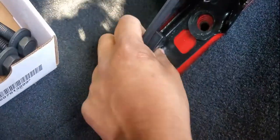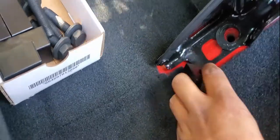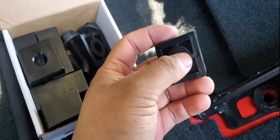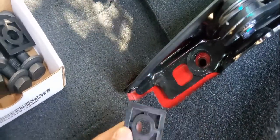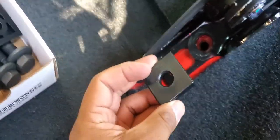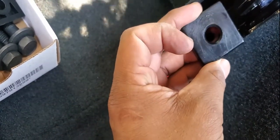We're gonna place the small spacers underneath the rear brackets, lift that part out, put the spacers in, then bolt it back on. Don't confuse these — the thicker ones are going to be for the front portion of the seat. The instructions indicate that the portion with the openings facing down — so when you install them, slide them in like that. Do not install them facing the other way. Make sure to slide them in underneath like this.